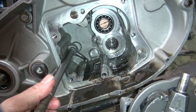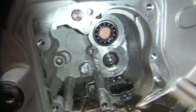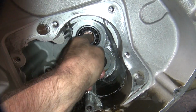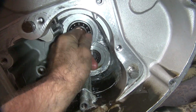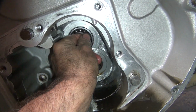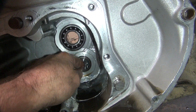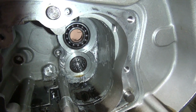You can see that it's not quite stock bearings in there. That's why the transmission doesn't break anymore. A little rough, but still good. Self-aligning double row ball. Not stock. Big roller bearing down there, definitely not stock. They have a little needle bearing that fails all the time. And the case has been reinforced everywhere. It's Maxim weld on everything.